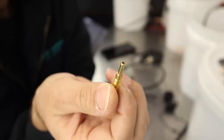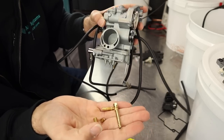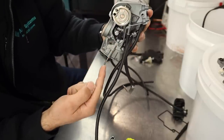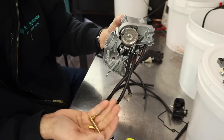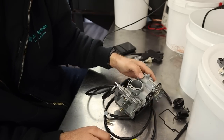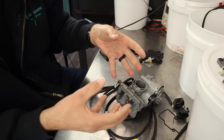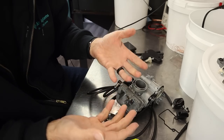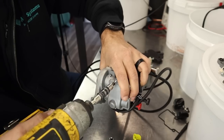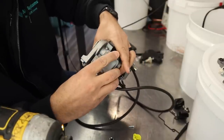As you can see there are several different jetting circuits in these FCR carburetors — and that's all in conjunction with any slop in the linkage, the accelerator pump diaphragm, the needle, and the pilot air jet. It's pretty easy to see why you might have problems when all these need to work together and overlap, at the mercy of elevation, temperature, and fuel octane. Now let's get the slide out — and as mentioned, the slide also contains the needle. It gets more complicated.